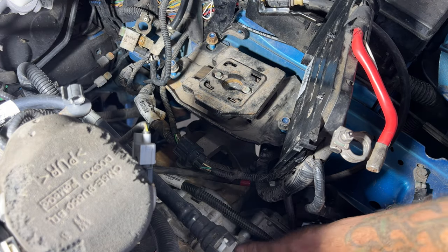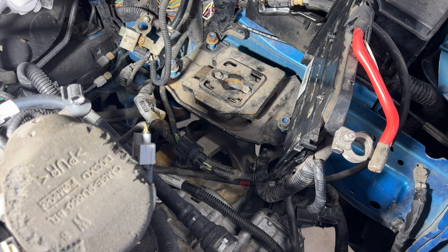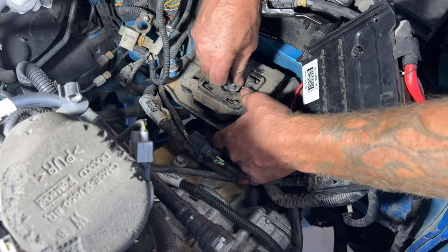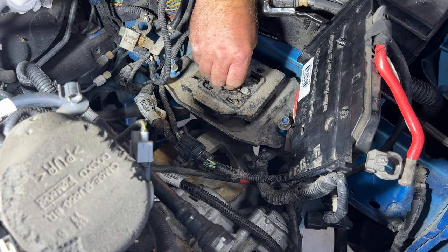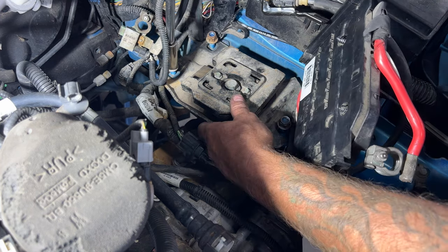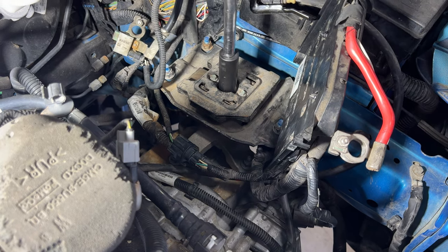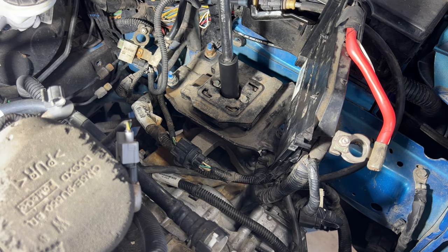And it looks like the transmission needs to go that way just a little bit here. So let me see if I can move my jack. That kind of started like that. Grab your 15 millimeter. Let's go ahead and get these nuts here tight. And then go ahead and grab a 19 millimeter. Let's get this snug, and then we'll torque it as well. Then you grab your torque wrench and you're going to torque that to 111 foot-pounds.